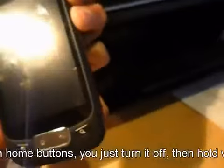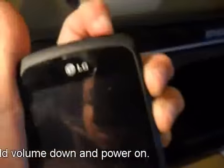If you get that problem, or if you have any problem with any Android device made by LG — as far as I know — you press the two volume buttons at the same time, simultaneously, and the home button, all at the same time, and then you press and hold the button to turn it on, and it will reset it to factory settings.